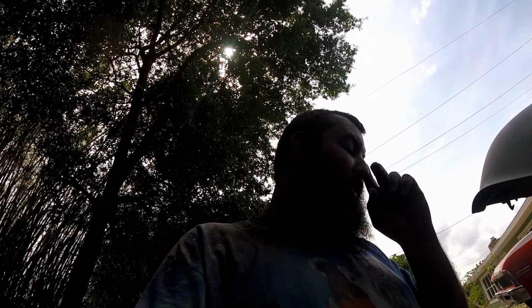I had an old '67 Camaro that came with a Powerglide, but it was pretty much a race car. Ended up just throwing that in: deep pan, stall, trans brake, you know, just the basic stuff.